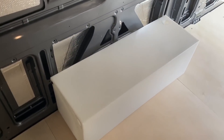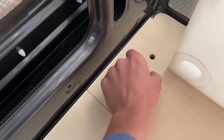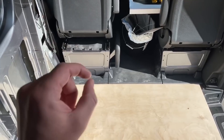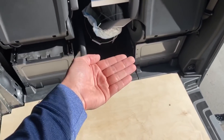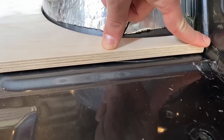Now we just need to add a couple more finishing touches. I have an over-wheel-well 32-gallon water tank, so I need to router out a section about a quarter inch deep to fit a quarter-inch aluminum L-bracket and attach it to the 8020. On the front side, the factory flooring is thick and the panel isn't lying flat, so I need to router out about half an inch on that whole front strip. Around the wheel wells, there's a bead of factory caulk that raises the panel about an eighth of an inch.